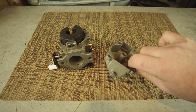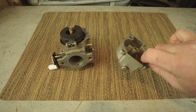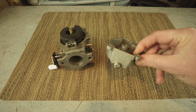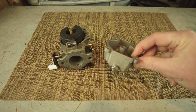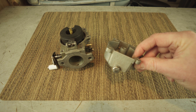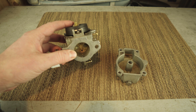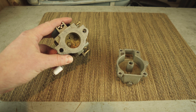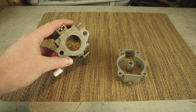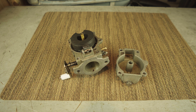The main thing I wanted to point out is that if this is happening, you absolutely don't want to be running the motor. Luckily our motor is old so it wasn't a big deal, but as I was testing it and finally figured this out, I was really glad I didn't keep it running for a long time — running a motor on one cylinder is bad in every possible way. This is how I troubleshot it: I put my hand over the air intakes and immediately noticed they were not the same — one affected the engine's performance and the other did not. Hopefully this helps and doesn't happen to someone, but I wanted to share the story in case it helps.